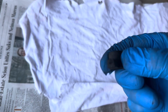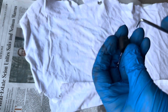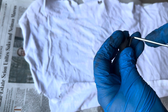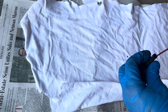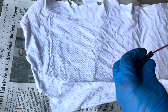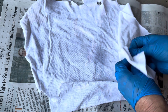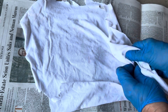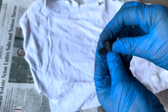The next step is to clean this out. Here's the part, and as you can see the end of it is completely clogged up. I'm just going to clean it out with a pick here, clean that out, and then put some brake cleaner through there. You can use anything to clean that — alcohol works too. It's all cleaned out now, and I can see all the way through there.